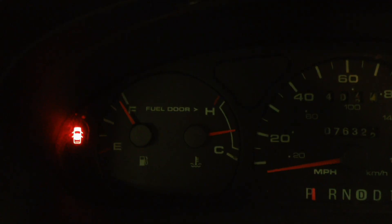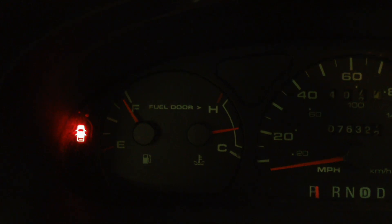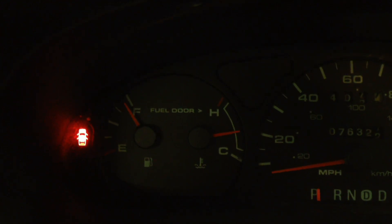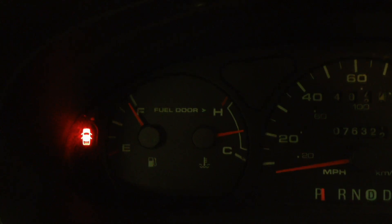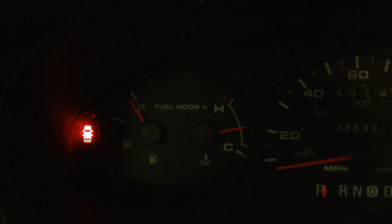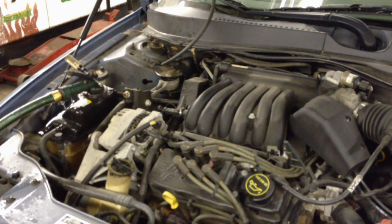Just open that thermostat up and get a full flush. Your temp gauge will be right about half or just below — that's how I know in general that our thermostat is working properly. Now that it's fully heated up, go ahead and pull that drain plug and start doing the real flush so we can get that iron out cleaner in there. Engine's fully hot. You can see clear water coming out over there, the top hose is nice and warm, and we've got flow so the thermostat is open.